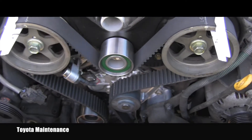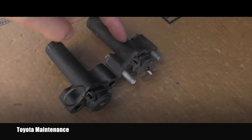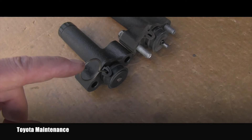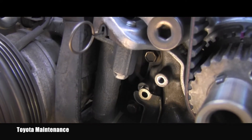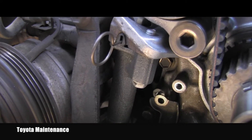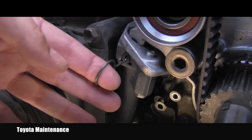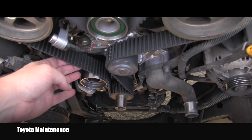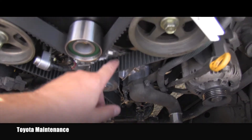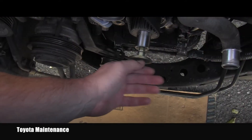Most importantly, I'm going to show you that last matching spot which is visible on the timing belt and on the crankshaft pulley — do you see that? That perfectly gives me assurance that this is correctly installed. Here you can see the tensioners side by side — old one, new one. This pin is still holding inside the tensioner. Both bolts are tightened to 27 Newton meters, and I'm ready to pull the pin of the tensioner and release it. I can feel there is proper tension on the timing belt.